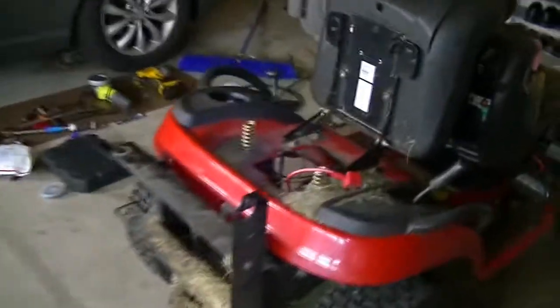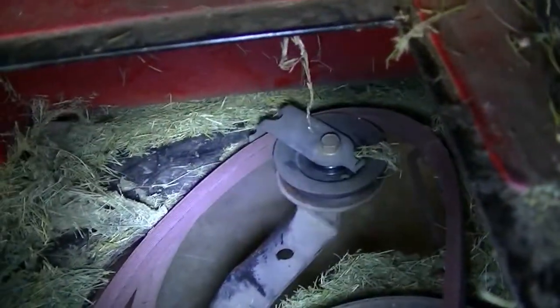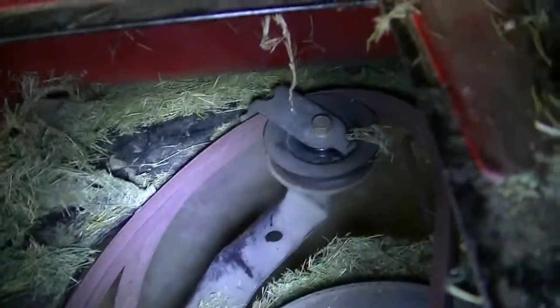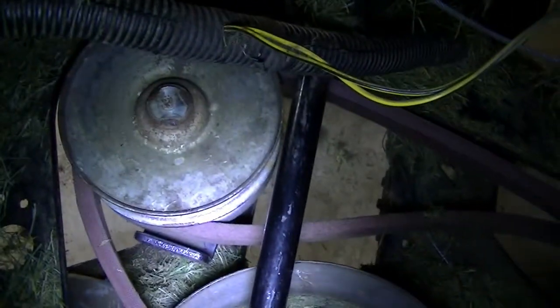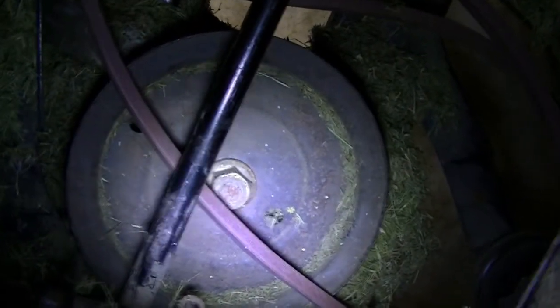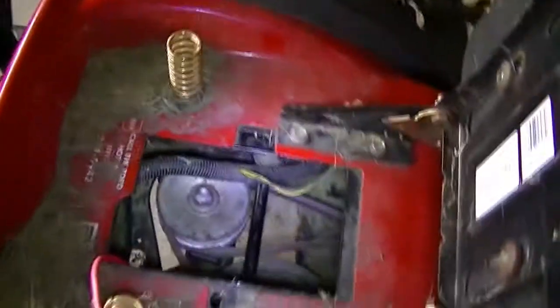Okay, it is turned back now, and the upper belt is already through this pulley, which was done when the mower was in the turned up position, and it went through this CV pulley also, the continuously variable pulley. The only one left is this third one, and I can see that the belt may not be easy to put on this one. It's already tight, but let's see. I'm going to open and put this belt on it.